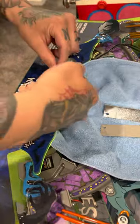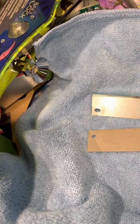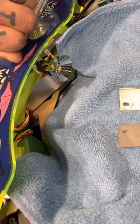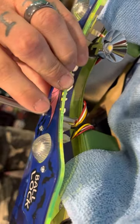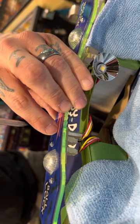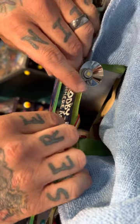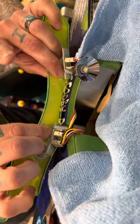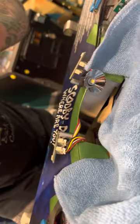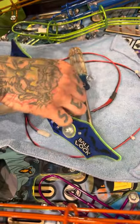Look under here — there are two spacers right underneath, so don't just pull it out and have them fall down. Go slowly, undo this one and get it loose, then come to the other one and undo that as well. Now we've got those undone. I like doing it this way because I can get my fingers on the spacers and hold them — then just put that to the side for the moment.